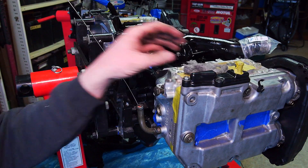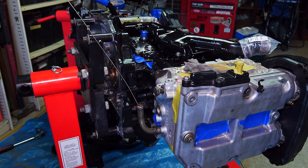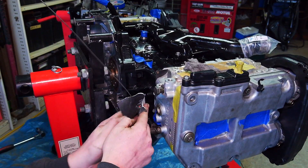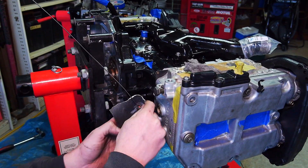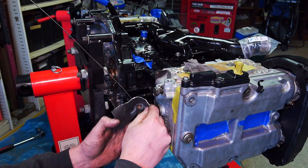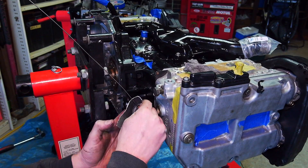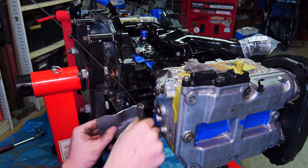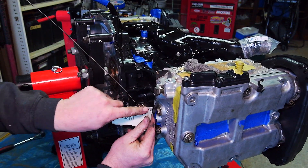So that's not really working too well with the steel wool, so I'm going to get some 120 or 240 grit sandpaper and rough it up better. The main thing you want to do is get all the top 10mm or so back to bright metal so that the epoxy will have the best chance of bonding onto it.